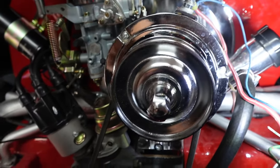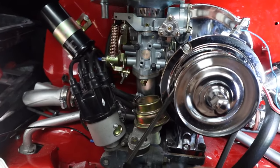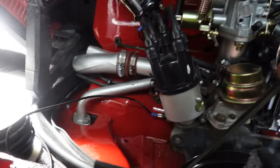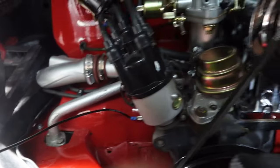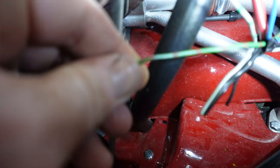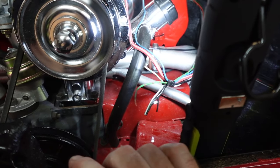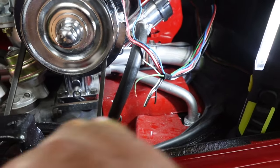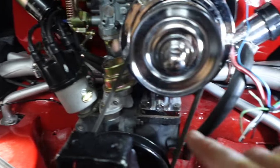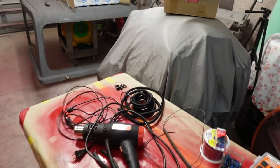I still need a hot wire from the front to the back to the coil. I still need the oil sending unit — oil pressure gauge — and this is the wire that goes to that. It's supposed to be this green and red wire here, but I'm getting no continuity on it. So I've stripped back all the sheathing looking for anywhere this wire might be broken. I think I have a spot up front where it might have been pinched. Probably tomorrow I'll go ahead and wire this all up. I've got new wire loom, which I think looks pretty good.